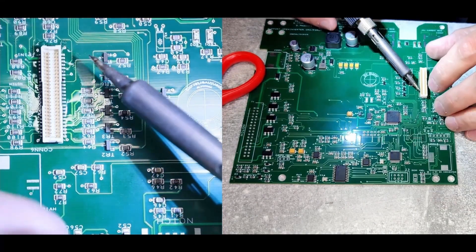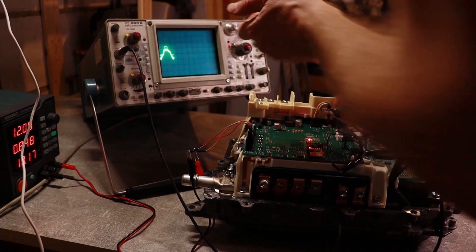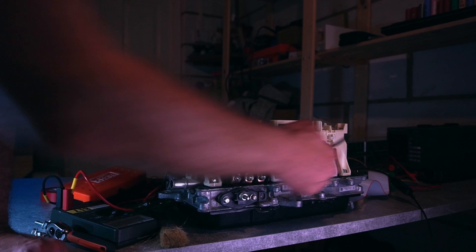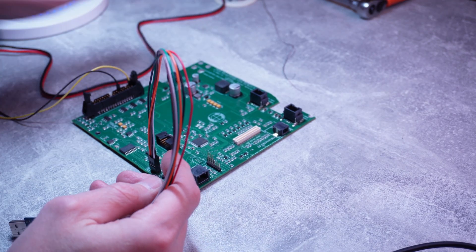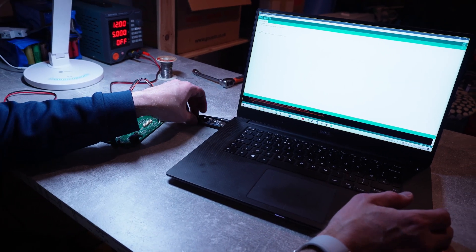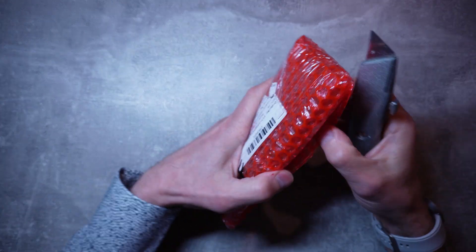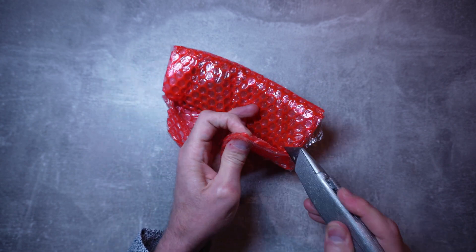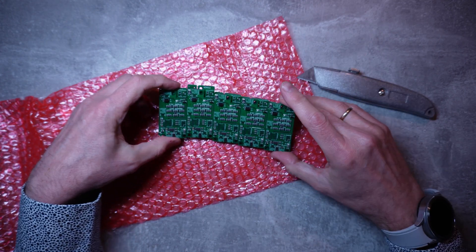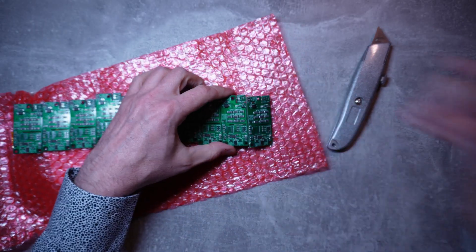Hello, I'm Ed. The challenge I set myself is to build an electric car conversion on a budget, so I was choosing components for my project very carefully. Now that I have a motor spinning in sine mode and performed an FOC tuning, I need to configure the battery, and for this I will require a BMS — battery management system. The modules are little boards mounted on each battery module connected in series, balancing the battery by discharging it through resistors.